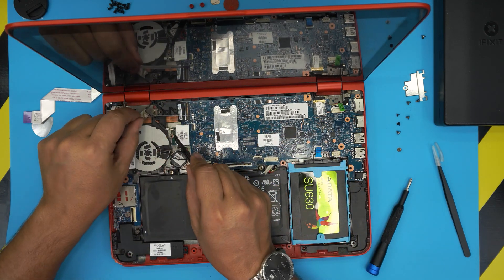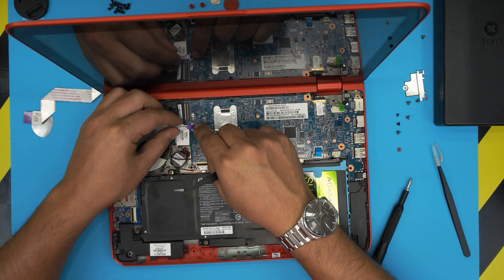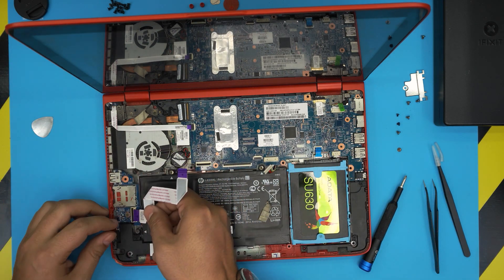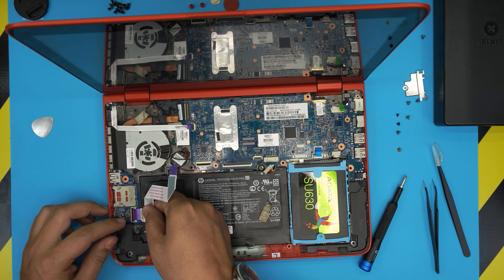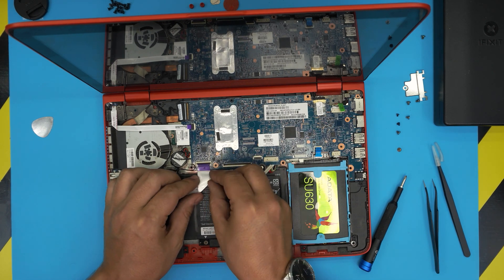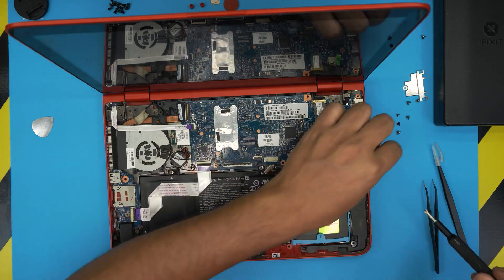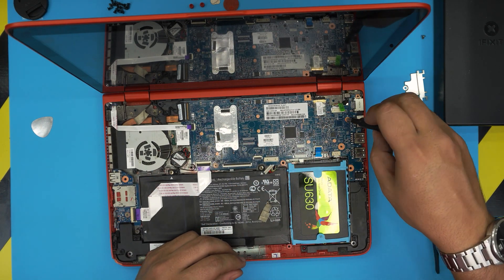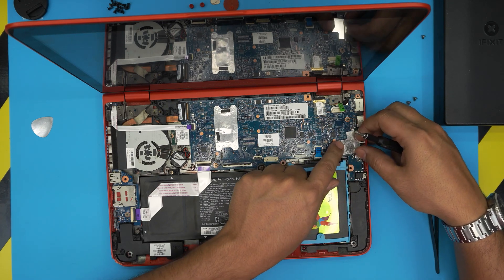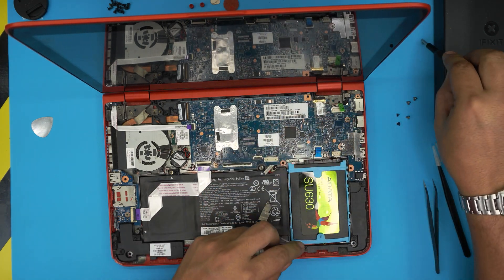Align the second Wi-Fi antenna cable and pop it onto the board. Connect the on/off switch flex cable, the I/O bridge cable, and lock them in. Grab the screws and start screwing the motherboard back in place — one over there, one here. The screw on this side goes with the plate, so put the plate on top first and then put that screw in.